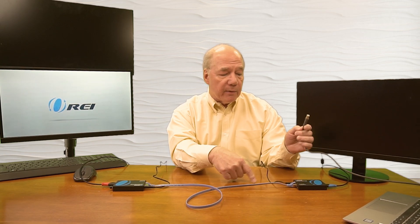Another cool feature is the KVM functionality. To use that at the remote location, you can connect up a keyboard and mouse to the USB connections on the end. I've got a wireless dongle here — I'll plug that in, and then I'll need to make a connection at the primary site as well. A standard USB cable plugs into a USB-A port on the computer; the other end plugs into the transmitter. Once I make this connection, the unit will recognize that I've enabled the KVM on this end and recognize the keyboard and mouse.